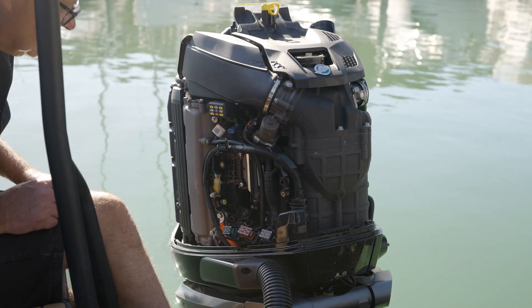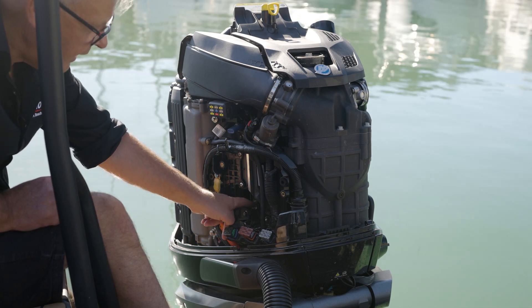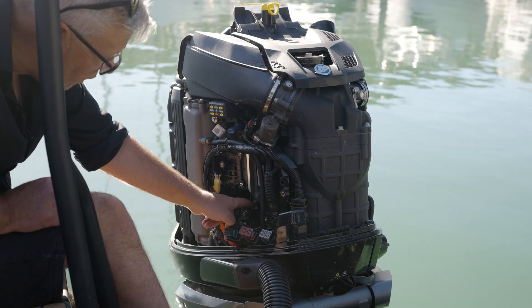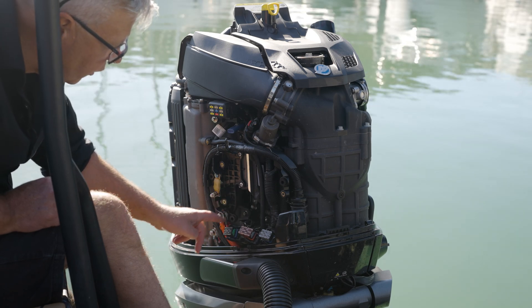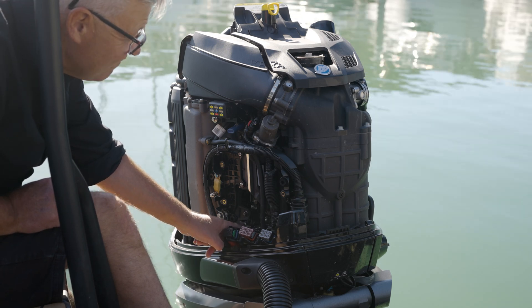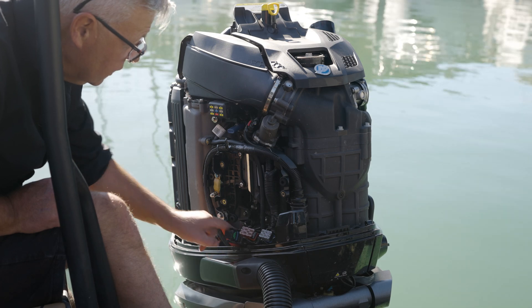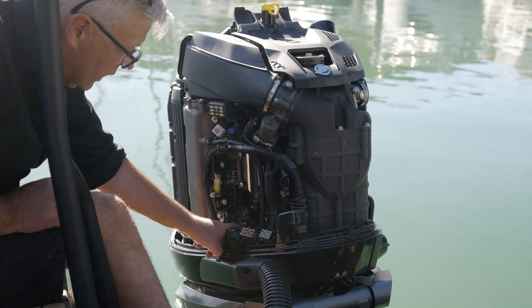There are two different variations of engines. Some have an exposed threaded hole for the knock sensor. If this particular engine doesn't have it, we move the earth straps from that bolt to a neighboring bolt and fit the knock sensor in that location.